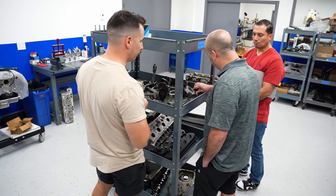When we build this thing, are we going to have tolerance for that 50 weight or go back down to a 40 weight? We'll probably put a little bit lighter. When you have an internal pump, the internal pump kind of dictates what that is — plus clearances, temperature, and all that stuff. An internal pump is sometimes a hassle. When the pump is outside the motor, it's easily adjustable — okay, we've only got 10 pounds at idle, let's put it at 30 — you can just easily change your speed. But once you put that thing in there and it's in there, you get what you get or else you're taking it back apart.